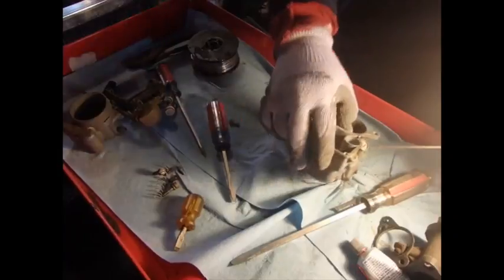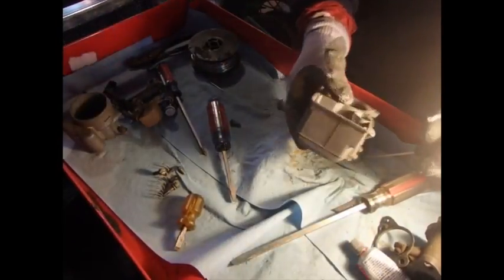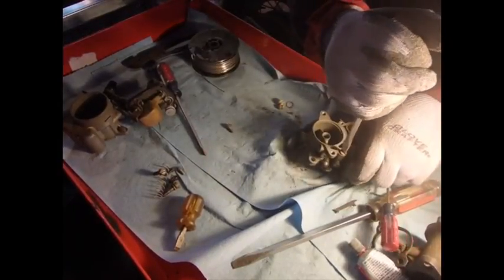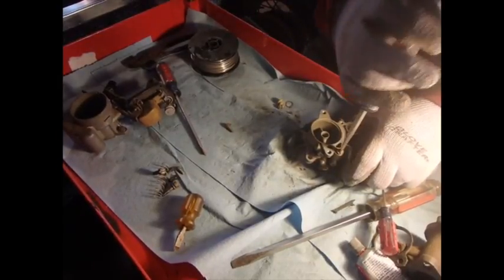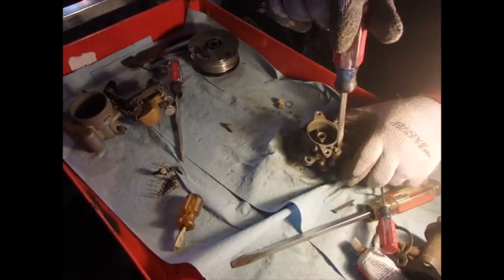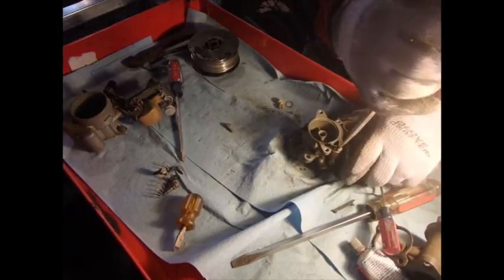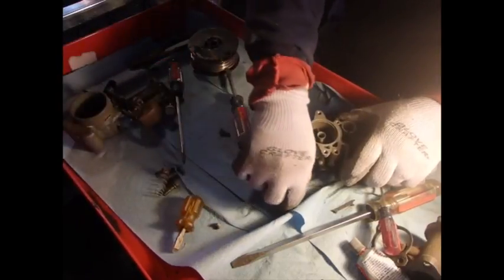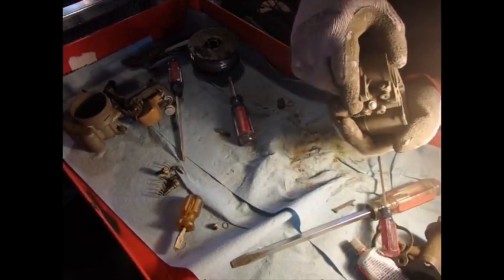Carburetors generally work if they're clean and they don't have any holes stopped up or anything like that. Sometimes you'll find a crack or something, but sometimes even that's not fatal. I've got a crack in the arm that holds my float up in that John Deere out there. I've been running it that way for years. I could buy a new carburetor, but even with just one arm holding the float, it works okay. So if that ever stops working, I'll know that I need to pay attention to that.